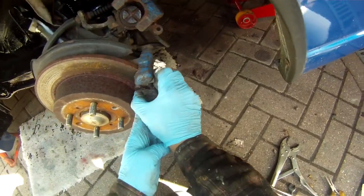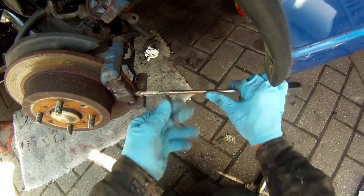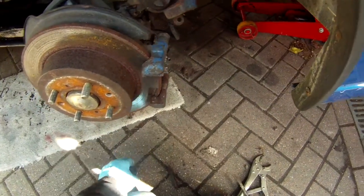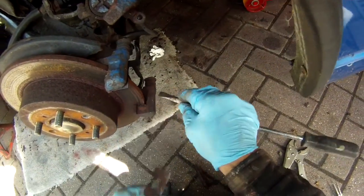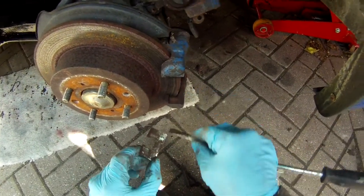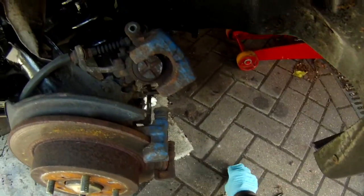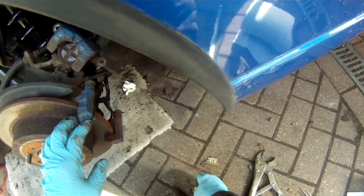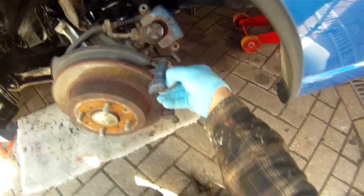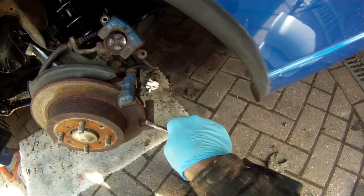Here are the brake pads — not too bad in this particular case. That one is quite stiff and well rusted on, which is probably part of the problem and why it's binding. What you'll often find on these brakes is rust on the under surface of this little spring clip, which pushes out the spring clip and clamps the brake pads too tight. So I'd like to remove the caliper bracket — it's got two bolts at the back, something like 15 millimeters — so we can sand off the rust.